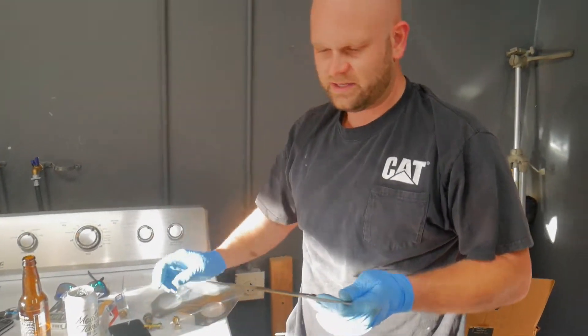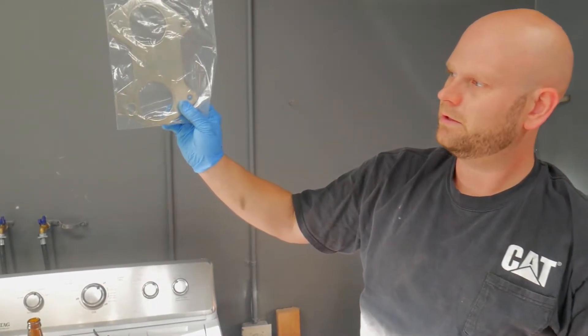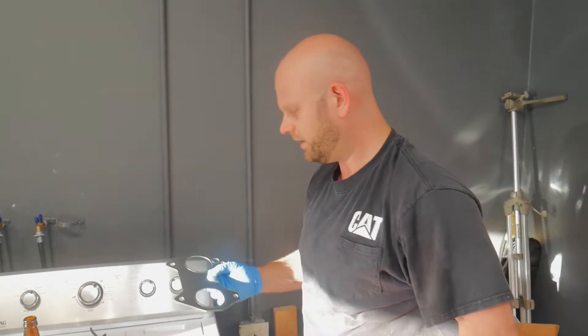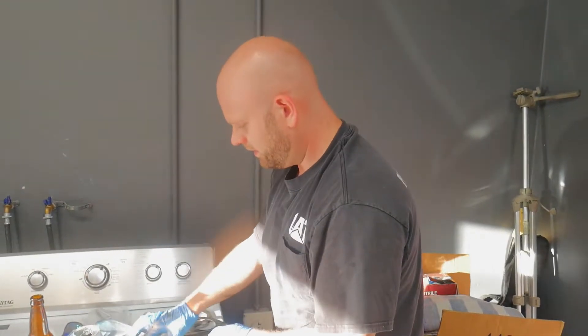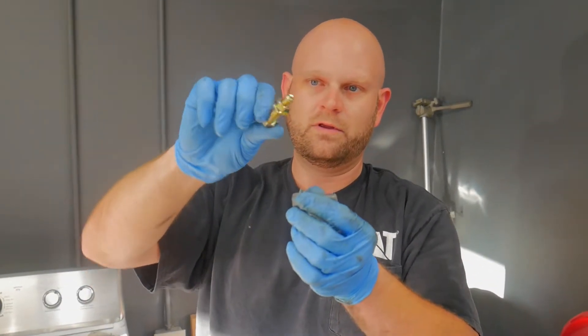We got the old exhaust manifold gasket out. This is the cheap kind you buy when you order through O'Reilly or Cragen or whatever. And this is an OEM piece — you can see it looks different. We're going to replace that because we definitely had a smaller leak coming from the manifold to engine. The bigger leak was from the two-bolt flange. I was using bolts with a really wide head, which wasn't tightening all the way to compress the gaskets — it was hitting on a portion of the mid-pipe. So we got some thinner diameter bolts which should be able to clear much easier and actually compress those gaskets.